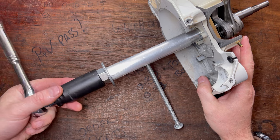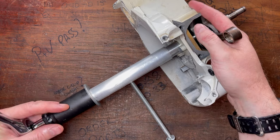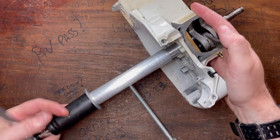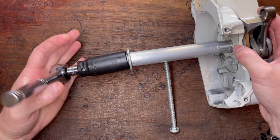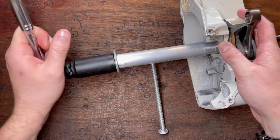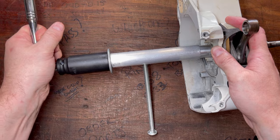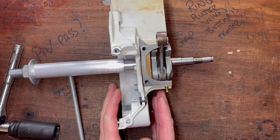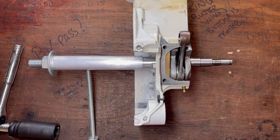Now really carefully, I'm going to gently pull that crankshaft in, making sure that the connecting rod is facing up and it's not binding on the case half. There should be minimal pressure here. If it binds, you stop. It's making a lot of noise, but notice how I'm literally just holding the wrench at the head — there's not a lot of force. You go until it stops. That is the crankshaft installed on the flywheel side. And because we've had this sleeve on the inner race of that bearing, there hasn't been any side load placed on the balls themselves.